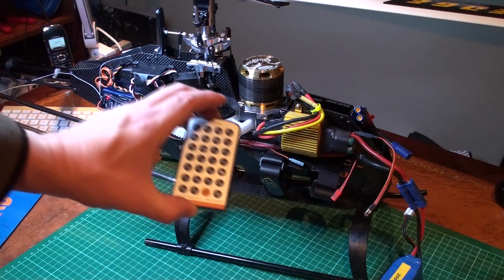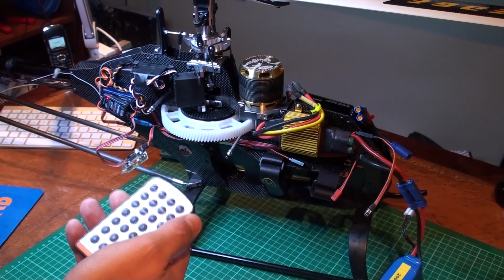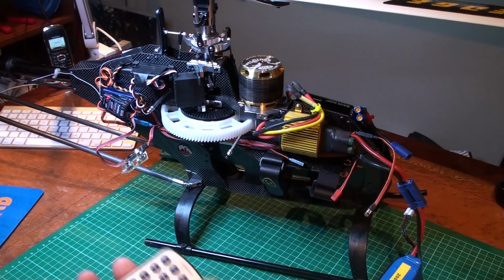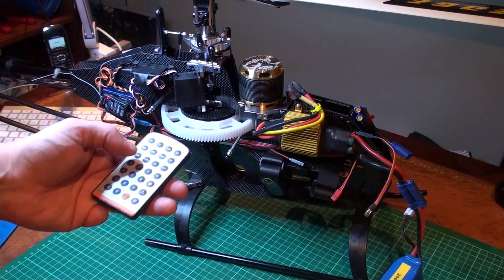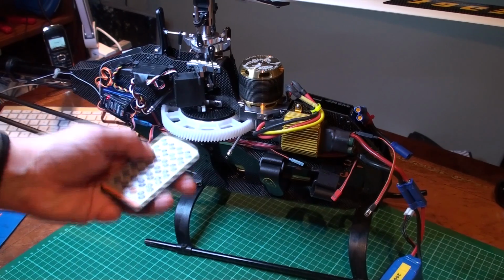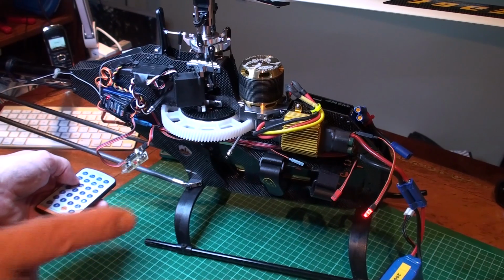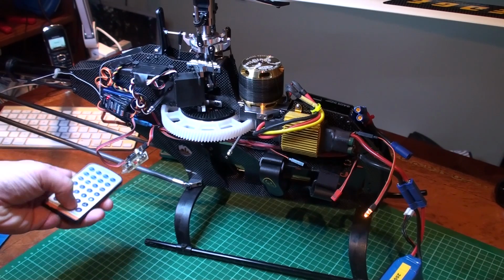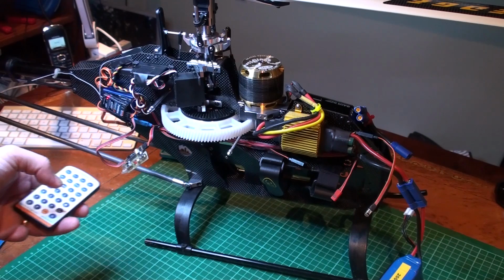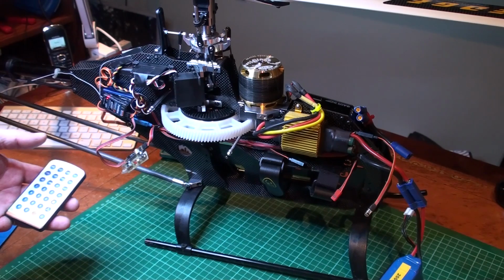Then I take my little control panel here, or remote control, and for the exact options you have to use the data sheet, the manual. But what I want to do now is program air, meaning mode 2, and then I aim it there. You see the light over there goes on, and then I take mode 2, enter, and then you get a confirmation. So then you know it has gone through. If I do something wrong, it will not give you that confirmation.